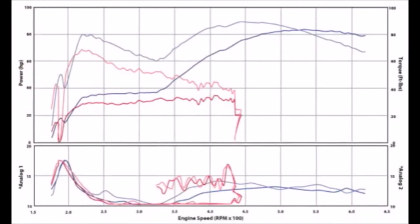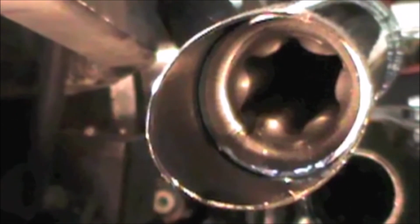Well, the bike is definitely quieter, but those baffles really did a number on the performance. We can't even rev it to 4,500 RPM, and we made a pathetic 35 horsepower. The AFR trace shows that the mixture went really rich. If you think about it, placing something as large as these baffles in an exhaust pipe really cuts down on the cross-sectional area available for exhaust to flow.